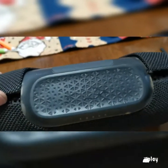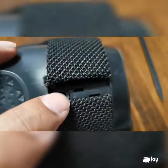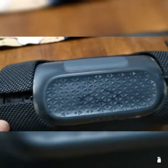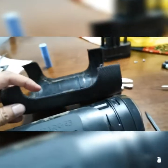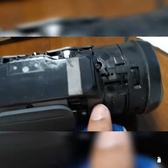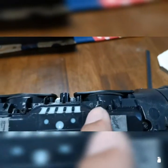Start off by flipping over or turning upside down your JBL Charge 3 and pry open this insert. You can actually find two screws in there, so just unscrew that then take the cover off. To remove the battery you actually have to remove these 7 screws on the battery cover.